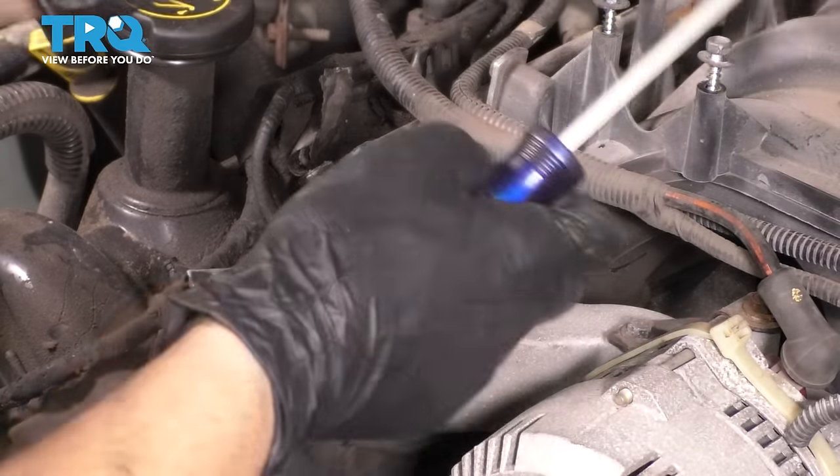13s. A nut over here, 13 millimeter, which holds the bracket for this AC component. And then behind that hides an 18 millimeter stud. So I figured this out. I'm going to pry the bracket for the transmission lines off of the stud, and with it pried off, that'll expose a 22 millimeter stud just like on the other side. Okay.